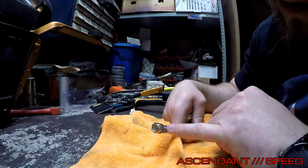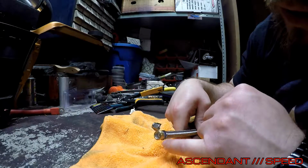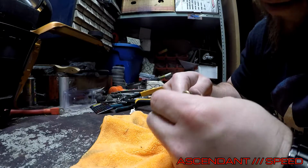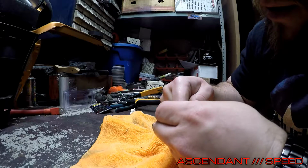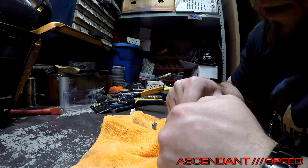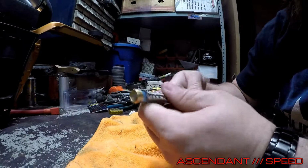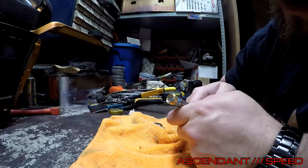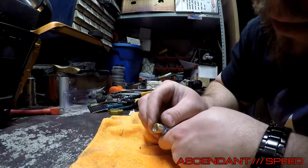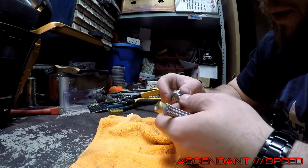You'll see, if you look closely, that in the ferrule there's a little seat. And when you push down, it'll seat against the Teflon. But really what you want to do is back that off just a hair so it's not completely against it, to allow for expansion. Anyways, I don't know if you really see that, but it's backed off a little bit. Measurement wise, I don't know.